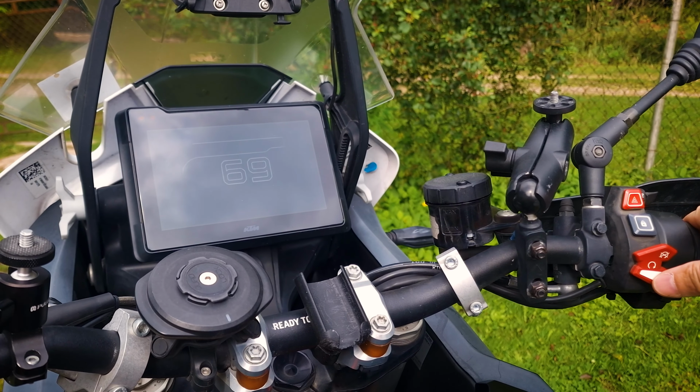The repair should start with checking the fuses. I thought I had a blown fuse that protects the fuel pump. I checked all the fuses with a multimeter. It didn't matter if they were related to the fuel pump or not. All of the fuses were good. I decided to check the connector pins around, and this is what I found.